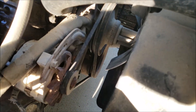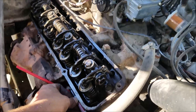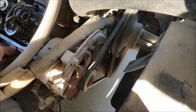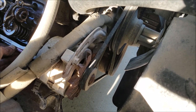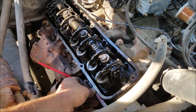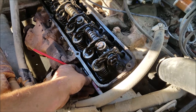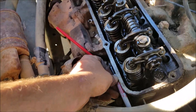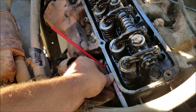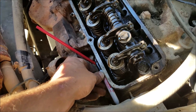The straw has to come up and touch in one place the same way every time so everything stays consistent. We're at top dead center of cylinder one as per the harmonic balancer markings. It doesn't matter if you're 180 degrees off — the crank rotates twice for every one rotation of the valve train. The compression stroke is best to be on, which I think I'm on right now. I'm going to make the mark on our straw, turn the engine over, and we'll check back.